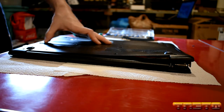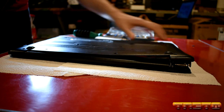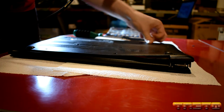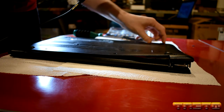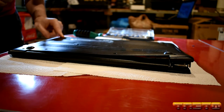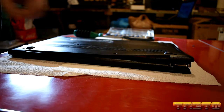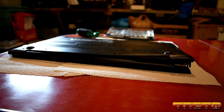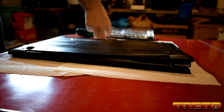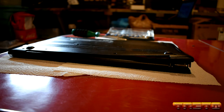Other than that, don't get a laptop. Stay very clear from laptops. Sometimes they'll also hide screws underneath these rubber grommets — these rubber feet — so you just have to pop those off. Another trick: if you don't have a magnetized bit, put a little super magnet on the side of your screwdriver barrel and that will magnetize it as well.